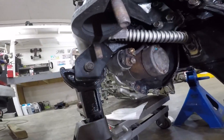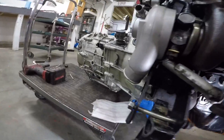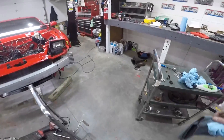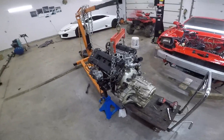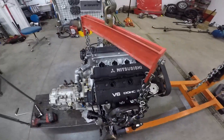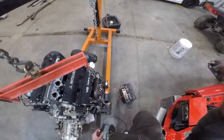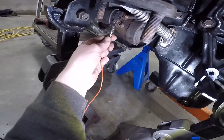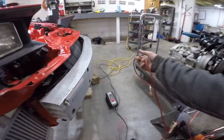Now how you want to hook this up: you're gonna want two power lines. One's gotta go here - this is your switch, that usually goes to your ignition, tells it to turn on. And then you're gonna want power to this, and then you're gonna want to put your ground on one of these bolts. That's how you get your starter to kick on. Get all your rags out of here. Have your spark plugs out - I ended up taking my spark plugs back out. One of you guys commented saying it'll be a lot easier to crank it, and you're right, I forgot. So get your spark plugs out if you got them in.